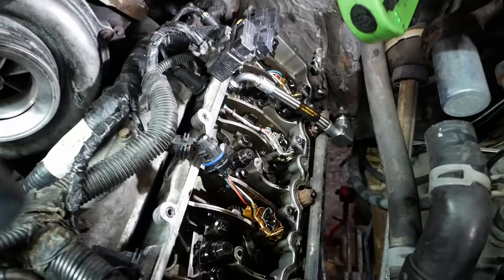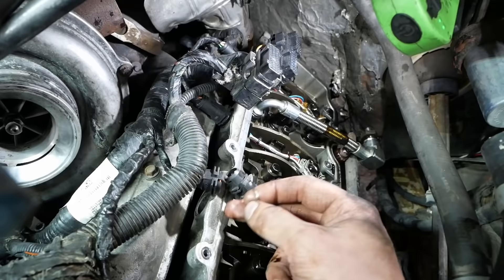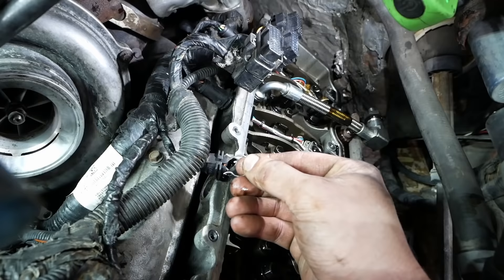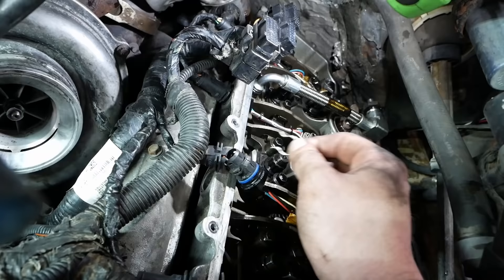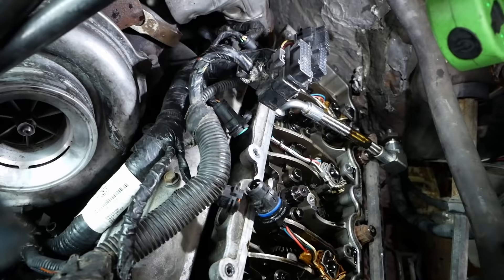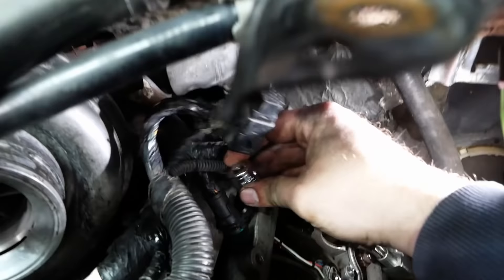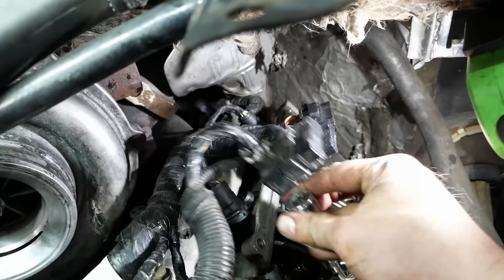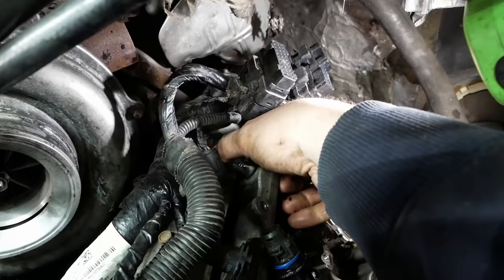This is the connector for the injector — it's got an O-ring and passes through the lower valve cover. The connector is held together with little metal clips. You can squeeze them and get them off — whatever you do, don't drop them into the engine. With the clip out, the connector comes right off. To get the harness out of the lower valve cover, I'm using an 11/16 12-point socket, which squeezes the lock tabs together so you can pop it right out.